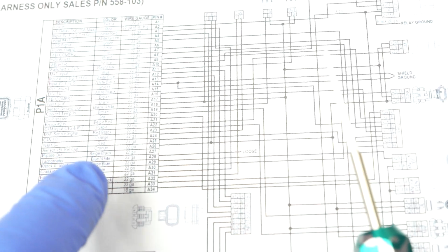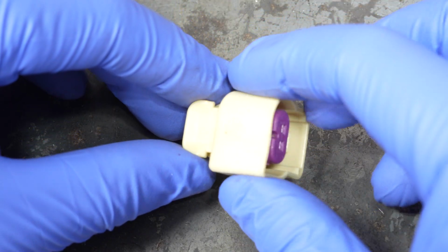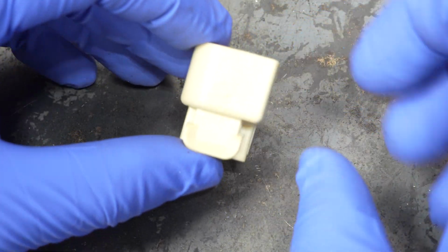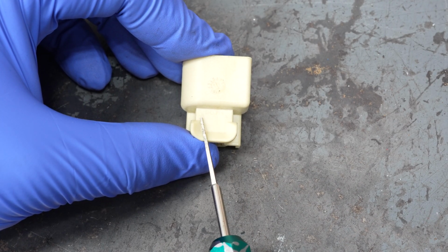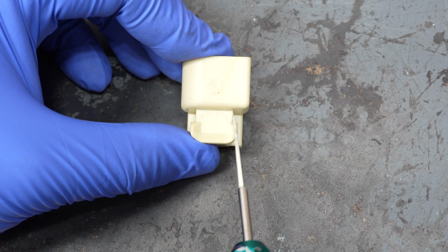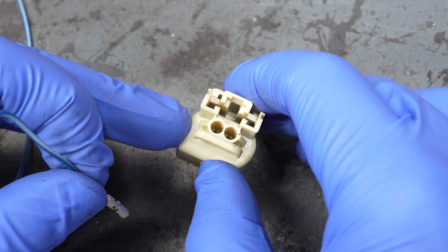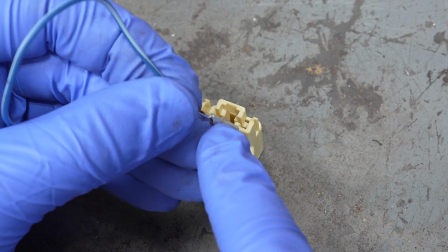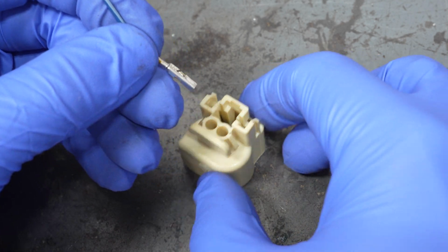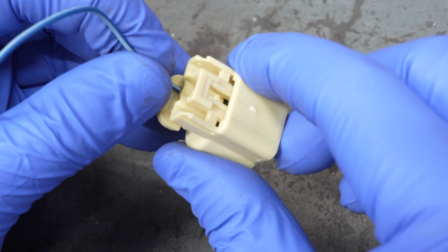So in slot A, we are going to want our blue wire, and then in B, we're going to want our black. And if you flip it over, it might be a little challenging to see, but right there is a little A, and there is a little B. So we know which one goes. If we look down in the connector, there's basically a groove sticking straight up that corresponds with this hanging off the top of our pin. So that can go into here, make sure it's on A, and it is. Slink that down in there.